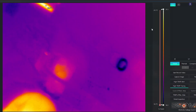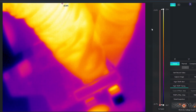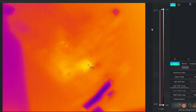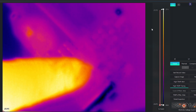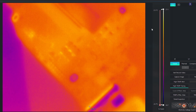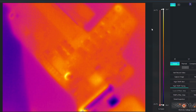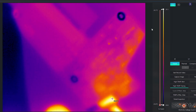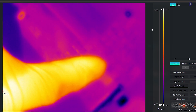Let's go ahead and remove the board and take a look at it further. Our power input is right here — you can see those are the two USB-C connections. Let's plug it in and see what happens. You want to check where the power is coming in. You're always going to see one of the CD32s get a little bit warm — that's your USB-C charging circuit. If I unplug it and plug it in on the other side, it's going to heat the other CD32, because with USB-C charging circuits, seeing them get slightly warm usually means they're healthy. Other times it can indicate a problem — it depends.